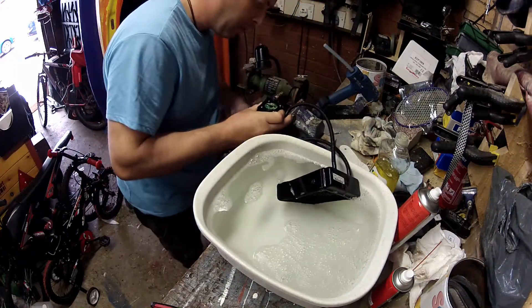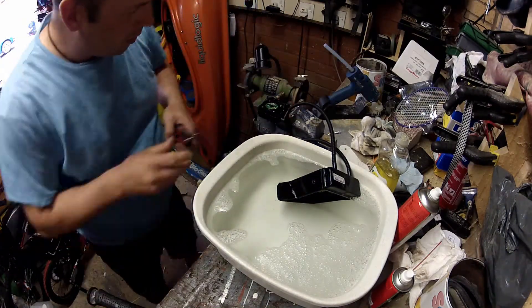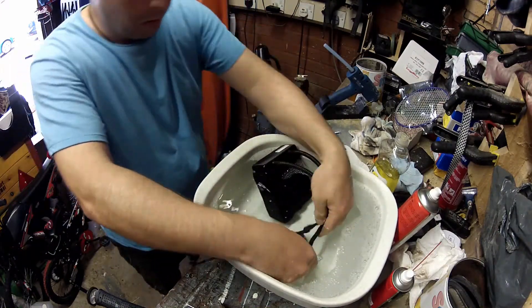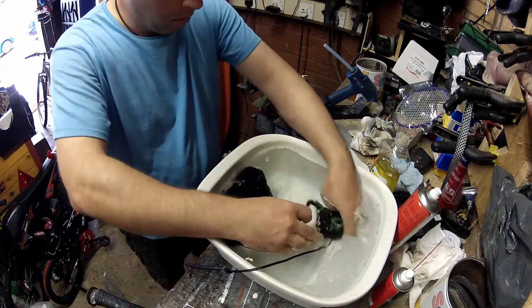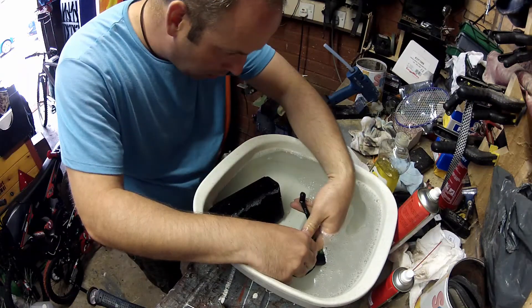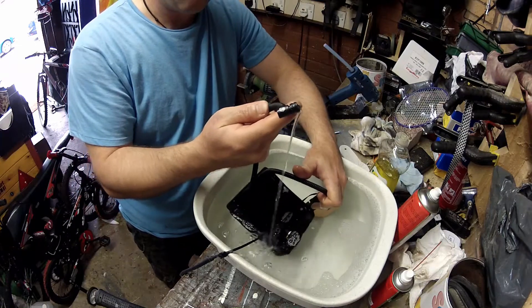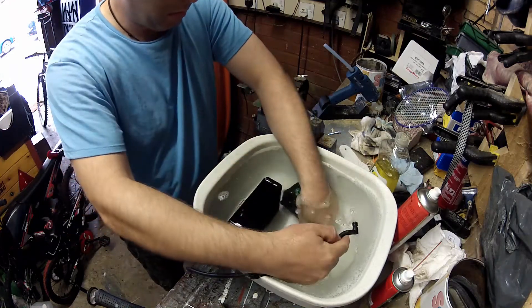What to do now is remove the hose on the suction side of the pump. On the Coolit Eco ALC 2 that's the centre hose, not the one that's offset. Once you've got that off, submerge everything under water and switch power on. The system should now be removing air quite easily. As long as you keep the pump under water it shouldn't draw any more air, but if you lift the pump above the water you'll have to remove that air again because it will draw in air. The pump is not a high flow pump — it's about 150 litres per hour — but you don't need much in a water cooling system.